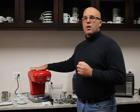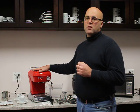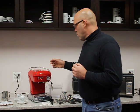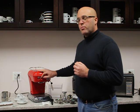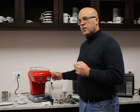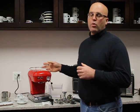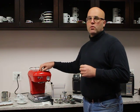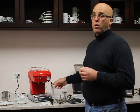Right now the machine is warming up. There is a cup holder on top — we don't necessarily call it a cup warmer because it does take about two hours to heat the cups up on top. When you first get your machine, you want to open the steam valve by turning the knob counter-clockwise, place a cup, and hit the coffee switch. That will get water from this reservoir through the hose, through the pump, through the thermal block, and out the wand. Once you have a nice stream of water, the machine is primed.